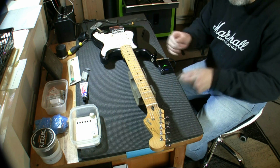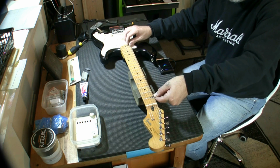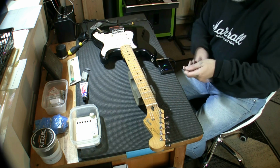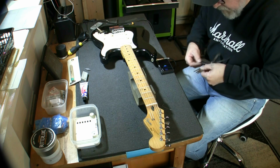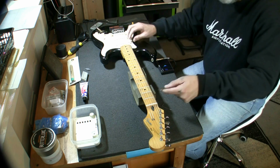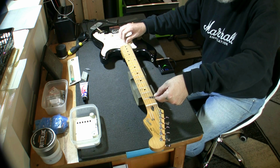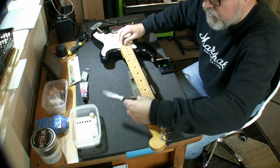So they are my measurements. I don't know if they're definitive or what, but that's really high. That's good. Yeah, that one's good. The middle two, I'll be looking at 0.25, so let's get that feeler gauge out. These measurements are in millimetres, by the way. I could come a little bit lower.